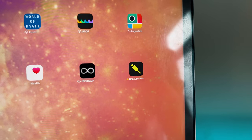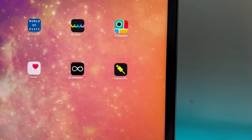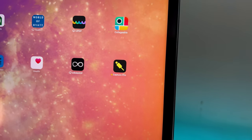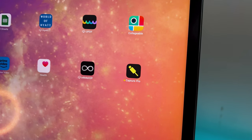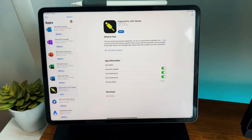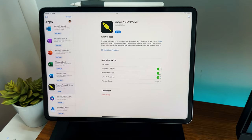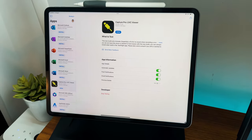Lastly, you're going to need an app called Capture Pro. This requires iPadOS 17, and the Capture Pro app is currently in TestFlight. I'll link it below — it's free to access depending on available slots. Just download the TestFlight application, get permission, and as long as there are openings it happens instantly. The Capture Pro app lets you treat your iPad as a dummy monitor, as if it were a regular TV screen with an HDMI input.